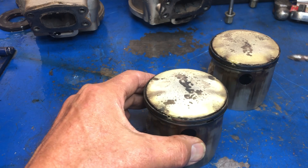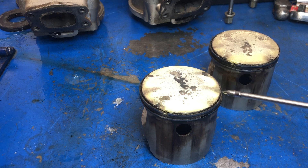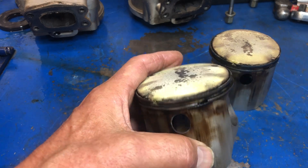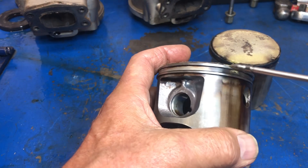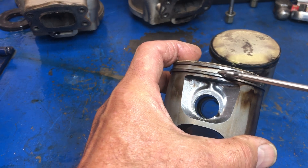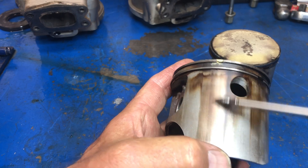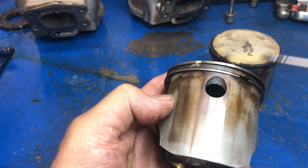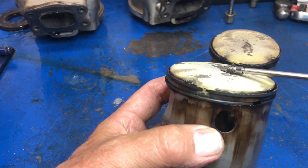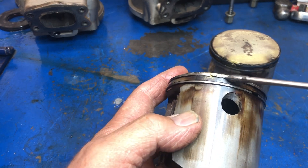Let's examine this piston and see what we can learn. The four points here — the piston wash looks normal, so this engine was running well before it started to drink its fuel tank. Now we see how black this is here — this is what we should see. This area is a normal color. Why is this all burned here? This is all resin. When we have a mixture on top of the piston consisting of gas, oil, and resin, when we combust it, the resin makes the piston rings stick so they can't seal properly.